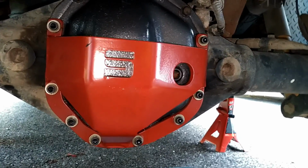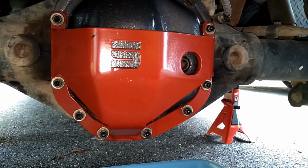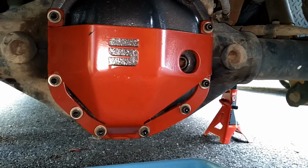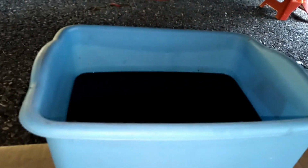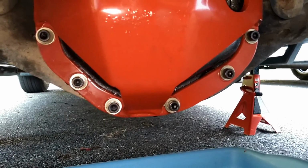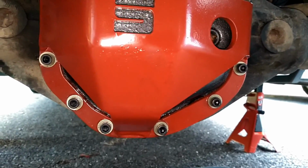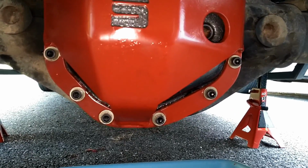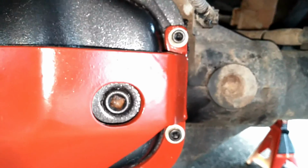And we actually have 3 vehicles currently, although my children are going to be taking one of them very, very soon. So the other one, of course, is my wife's daily driver. And so here's my drip pan, where I caught all the old oil which had come out, and if you see a little bit dripping from the bottom there, that's not actually a leak, that's just the overflow, because the proper recommendation to refill one of these is that you refill it until it starts to leak out of the fill hole a little bit, and at that point you are done. And so go ahead and get a shot of the fill hole there.